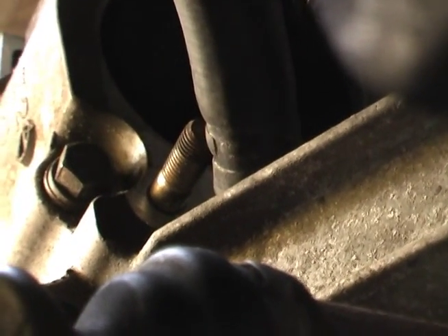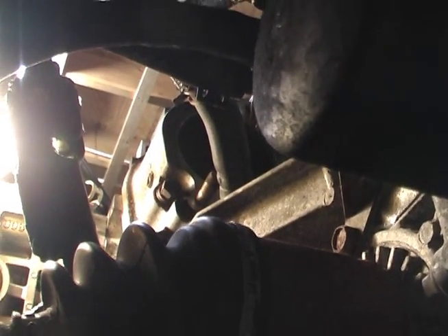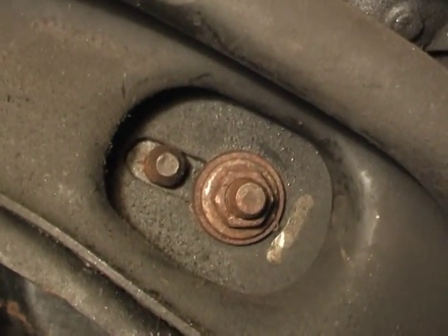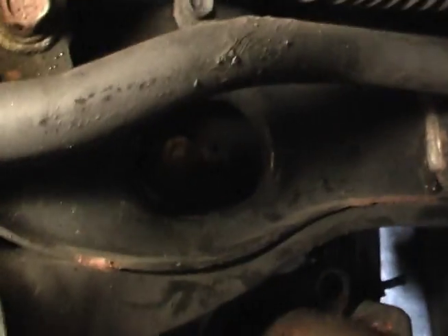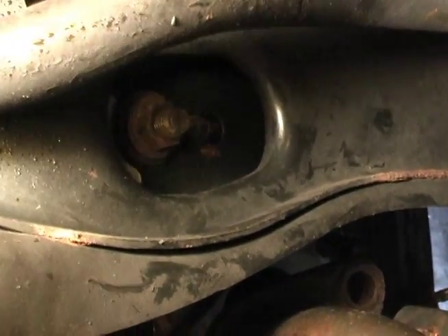In addition, you have a nut that goes on the stud but that's just to hold the starter in. So those are all the engine bolts. Once you get rid of those, the top mounting bolt, and then this one lower engine mount nut, and the twin to that right over there — the engine can come out.